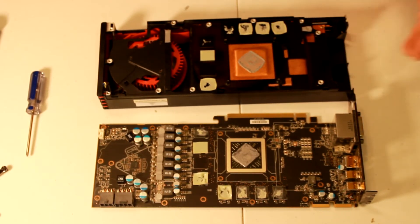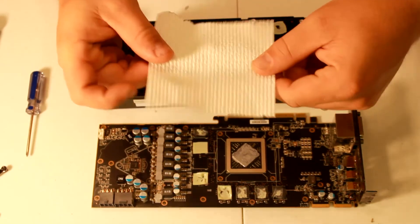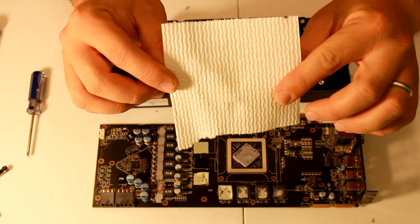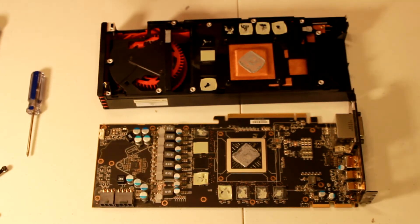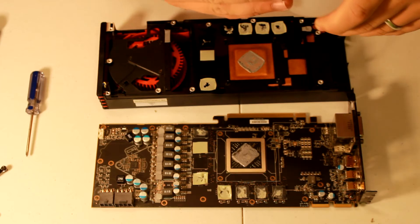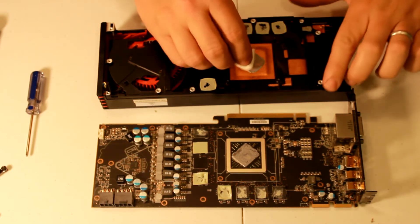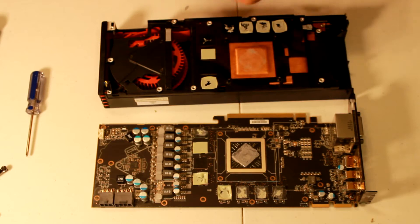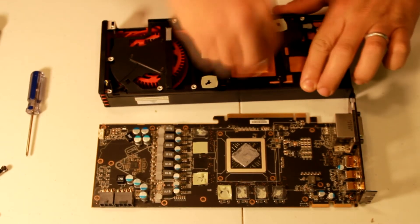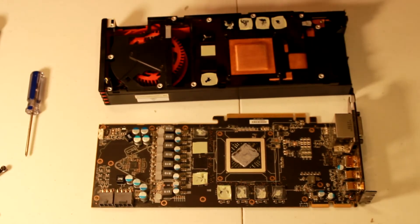If you do have to take it further apart, you're going to have to go somewhere else for that. Just take a regular piece of toilet paper, fold it up a couple of times, take your alcohol, pour it on there until it gets a little bit wet, and wipe until the paste is off. You'll probably have to take a couple pieces of toilet paper. Keep wiping until nothing comes off on a dry piece and then it's clean.